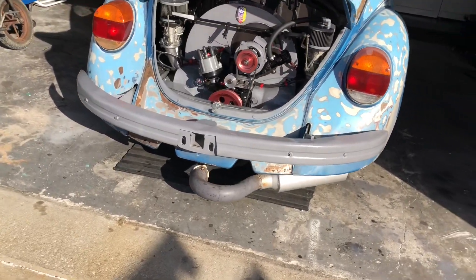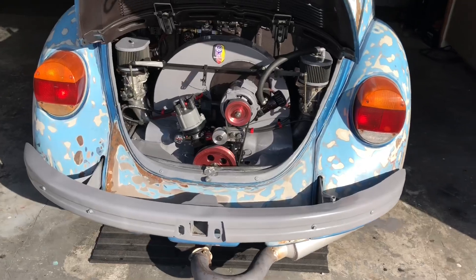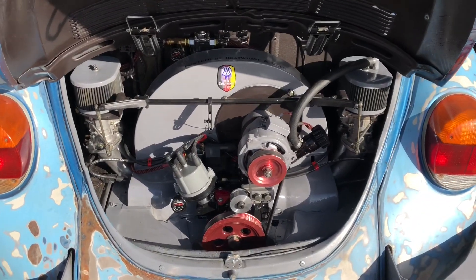So let's get into this Q&A session and go over some of the details real quick on this hot 1915. Here's some of the questions I've been getting and why I'm calling it a hot 1915. It's a 1915cc engine — we went from 87 millimeter to 94 millimeter bore, and used the same forged crank and rods, stock stroke crank of 69 millimeters. Do the math: 1915cc.